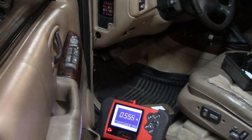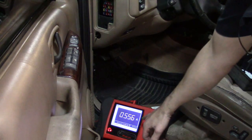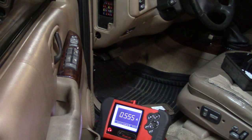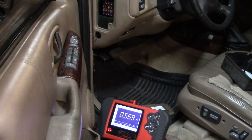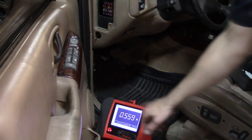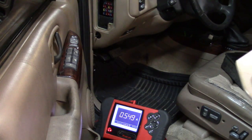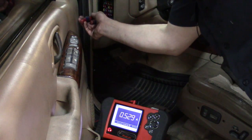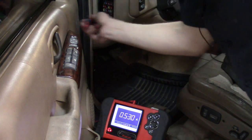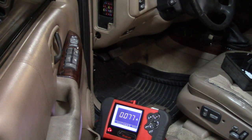I've set up my low amp probe onto a scope, but this is the same thing as you would do with your DVOM. I'm only using the scope because of the large screen output so you can see it easily on camera. Since I'm suspecting the stereo system is the most likely cause for the high amperage draw, we're just going to pull the radio fuse. When I pull this fuse, let's see if our amps drop — and check it out, they do. When I reinstall it, we see the amperage return. So we know the radio circuit is without question responsible for that amp draw.